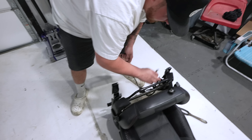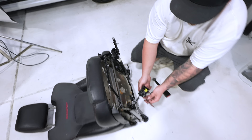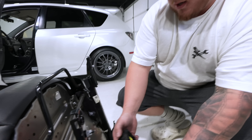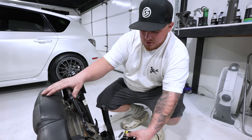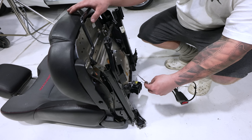Randall's going to show us what we're going to do. We're going to put a resistor on the seat belt right here — he's peeling back the wires. Essentially, you have to have communication going back to the car, and that communication is carried by this harness right here. Our seat belt plug is right here. What we need to do is back-probe the back of the main harness, hook it up to the resistor, and that'll just plug right into place underneath the new seat. We'll figure out a way to get these bolted or mounted, and then we won't have any codes or any lights.